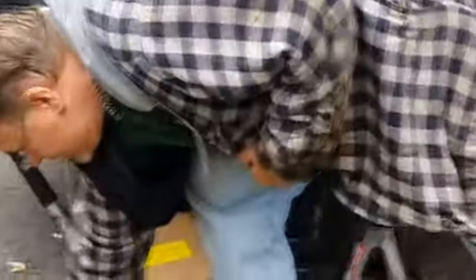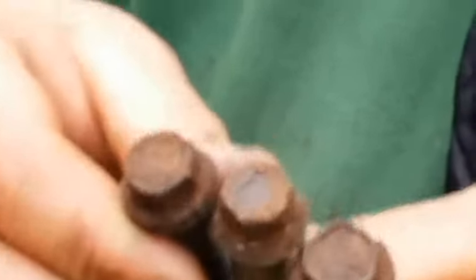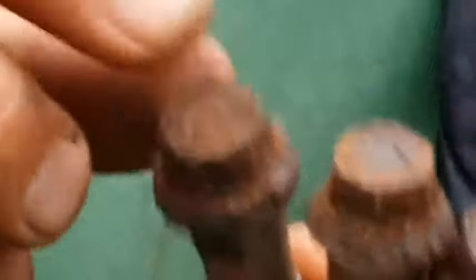One trick I want to show you before you get in trouble: these are the old hub bolts. They were so corroded that if I tried to take them out with a 16mm or even a 15mm, they would have rounded right out. I wound up getting down to a 14mm — wire brushed them up and then beat a socket on there to get a good bite, and then backed them out. Before you go rounding them out and wind up in deep trouble, clean them up and see if you can get a tighter socket on there.